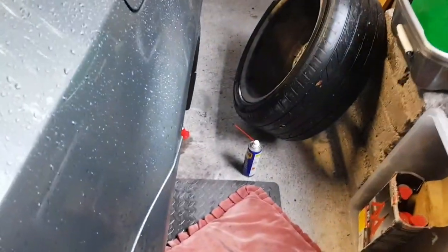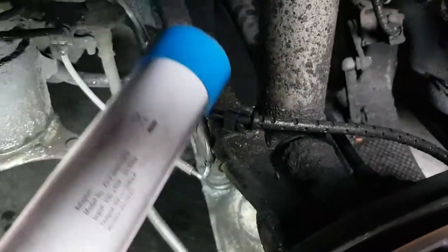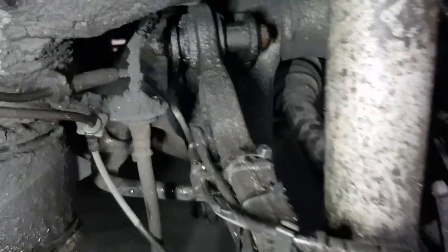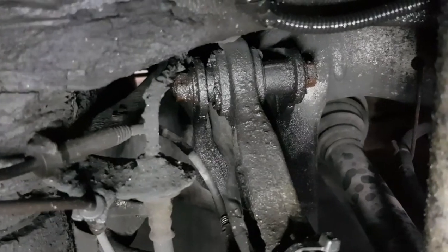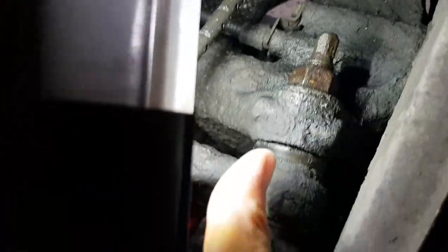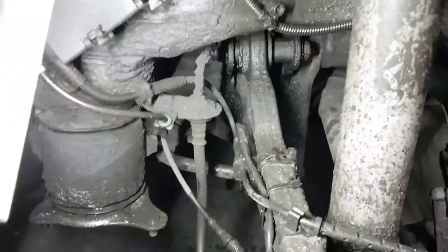On it goes, that's it there, with the various lines attached to it. So as you can see, it's attached in there by what I think maybe 18mm fittings, but I'll come back to you on that. And then it's also attached here. The reason why I'm changing it is because this ball joint here is perished, so in order to get through the MOT, I'll have to change this arm.